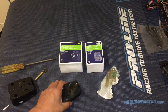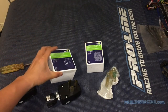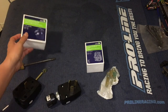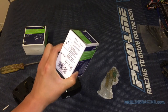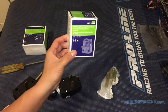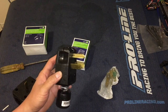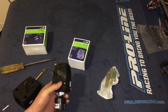We're going to show you how we made this. I actually bought two plugs here. In our garage we have what's called a 14-50 configuration — that's this plug over here, a Leviton plug from Home Depot available in a variety of configurations. I also bought this standard dryer plug, which I think is called a 10-30 — basically 30 amps. When I'm on the road and I know there's a dryer plug available, I can reconfigure the plug quickly to charge from any standard dryer outlet.